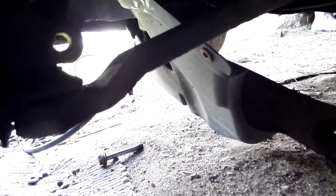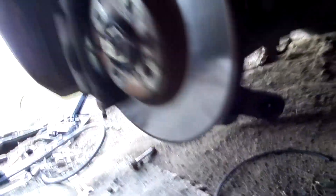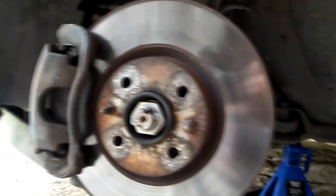Right, time to give you guys a bit of an update. We just need to release this ball joint here, and once that's released the rest of this should come out. This side has been undone, that side over there has been undone, that bit's been undone as well — it's just this ball joint here to release and then it should just drop straight down. Put a new one in place and bolt it all up, lovely jubbly. But anybody who deals with cars knows that ball joints are the worst. There's also a plastic cover hanging down here which is the absolute bane of our existence. Shout out to my dad for helping me out with this because I'm just learning as I go along.